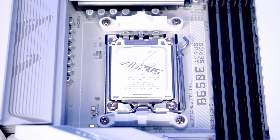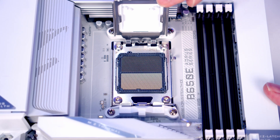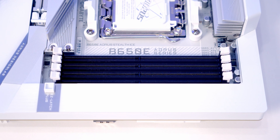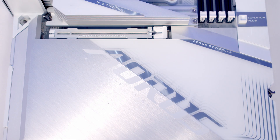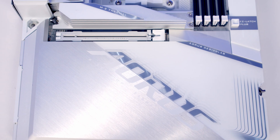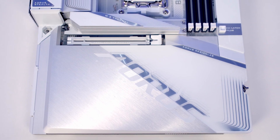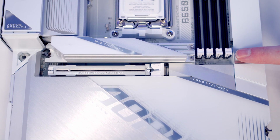In the middle of the motherboard we've got our AM5 socket with standard mounting brackets, and the motherboard is compatible with Ryzen 7000, 8000, and 9000 processors. We've got four RAM slots accommodating up to 192GB of DDR5 at up to 8000 MT/s overclocked. The motherboard features a single Gen 5 x16 PCIe slot running in x16 mode with lanes from the CPU. It's good to see this slot is reinforced, and there's an easy latch plus button just to the right of the RAM to release the clip.